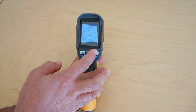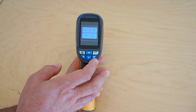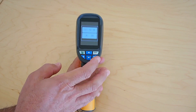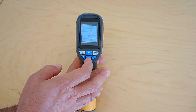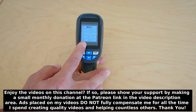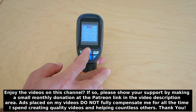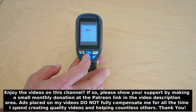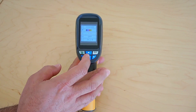423 is the time. You have the year, the month, the day, and that's the current time. So let me go back to menu. Up here you could adjust the target that moves around on the thermal imaging — I leave that off. Now this is the emissivity — you hit select and then you can change it up and down. We'll leave it at 95.